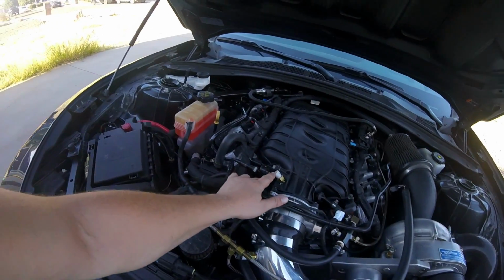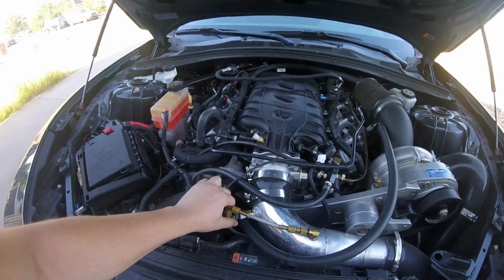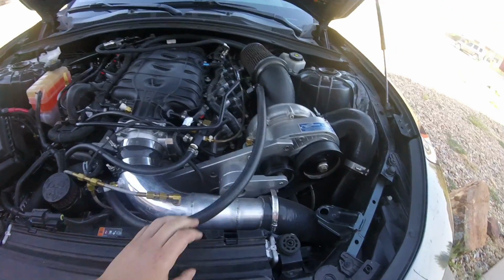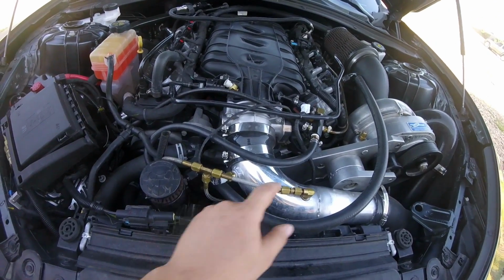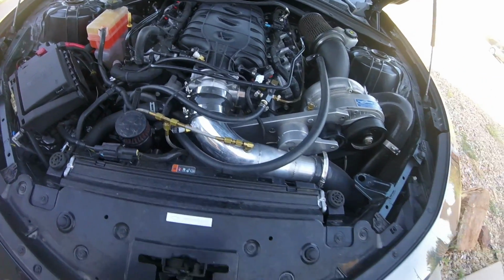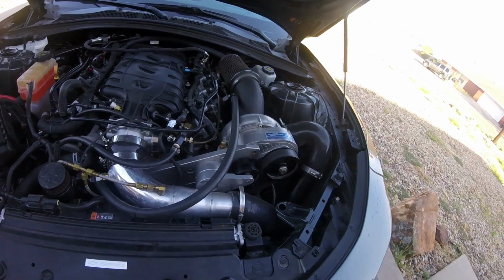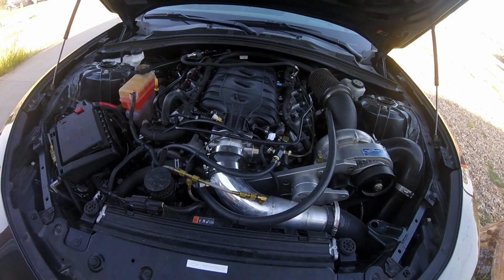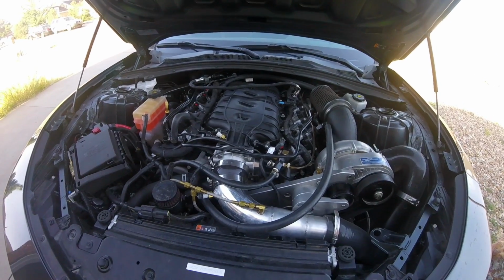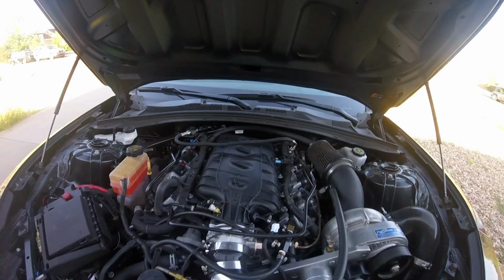So I'm moving this IAT sensor out of the intake manifold, and I put it here. It's all connected already. I went to this aluminum tubing piece just for that little stretch. I also did dual nozzle. I have a 10 and a 15, and I may or may not have to change belts. Well, pulley size, I don't know. I'll figure that out after this dyno. I don't want to be pushing too much power before I end up doing my next round of stuff.